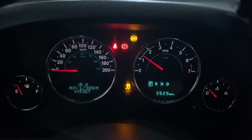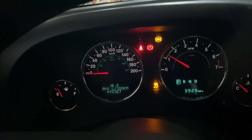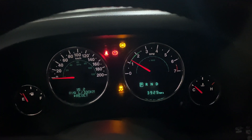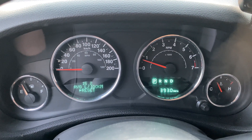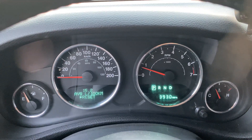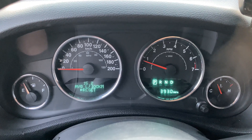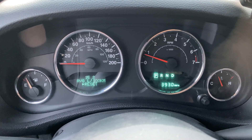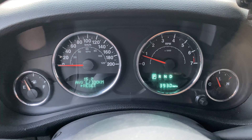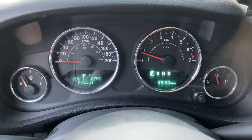The warning sensors are still on after the repair - some sensors won't self-clear until they actually get a signal from the sensor. As soon as I went over 10 or 15 kilometers an hour, boom - all the lights turned off. I can now actually turn the cruise control back on and off. Looks like this is done. Hope you found this interesting - thanks for watching, please subscribe if you'd like to see more content.